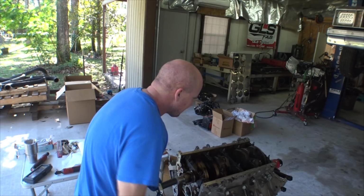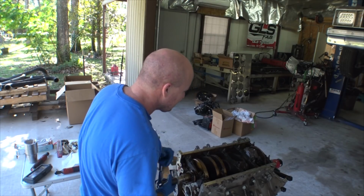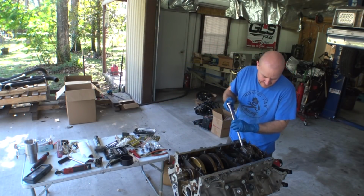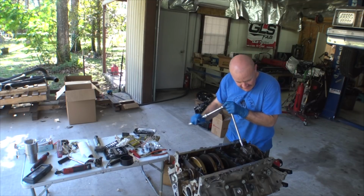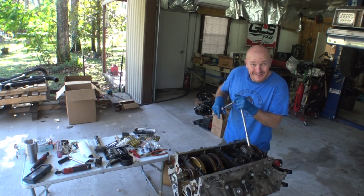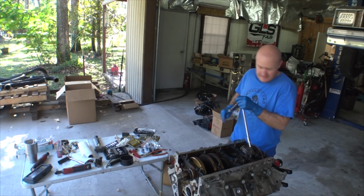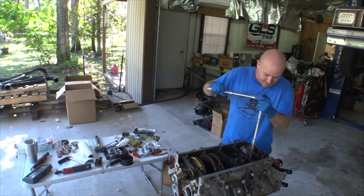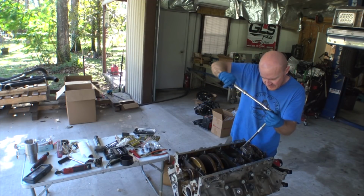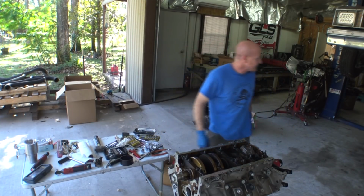I think we are back. We are back. I'm back. Let's back these off because I know I've already passed 15 foot-pounds, but I wanted to see how it felt turning the crankshaft, because if you feel any binds, then you know maybe you want to check those clearances. But no binds, we must be good. There's no binding, so the clearance must be perfect.